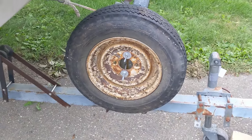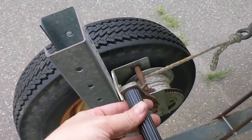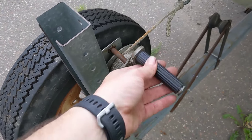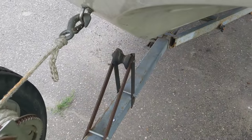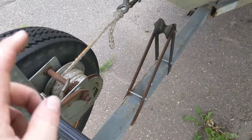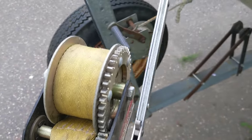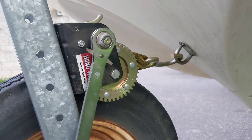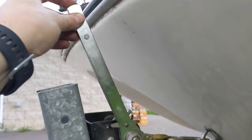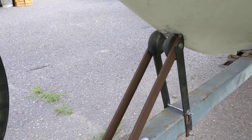You might notice that I saved the one good original tire as a spare — not a great spare, but better than nothing. What's worse than nothing is this existing winch on the trailer. When you crank the handle around to crank the boat up, the handle collides with the hull, so you can't actually get the boat all the way up onto the front roller where it's supposed to go. So I'm going to replace that winch with one I had lying around — a ratcheting winch where you can pull the arm back and click it forward without going around and around every time. So we can just keep cranking until we're right there on the bow roller.